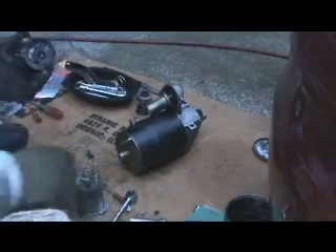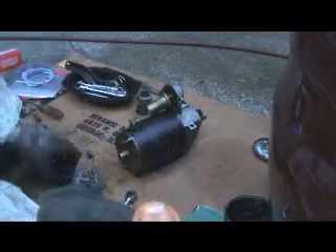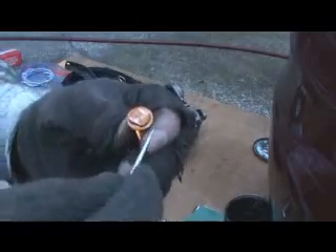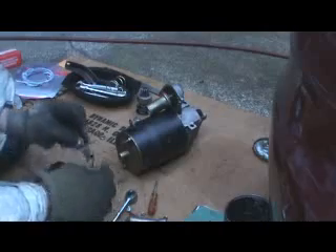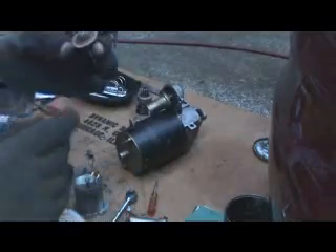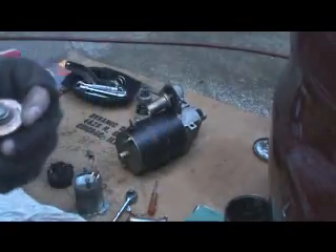Something fell out of here. This thing's not very worn — I've seen these where this whole area right here is worn down from contact. That's just barely even used. This contact disc — all right, that is chattered all the way around the edge. This is where it makes contact between the starter and the solenoid. It rotates so it'll always find a new spot to make contact, because this is high current and it does use this up. I can see I've already worked on this — there are striations from a file I've used on it before.